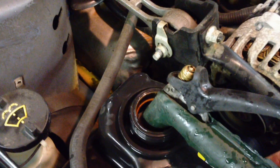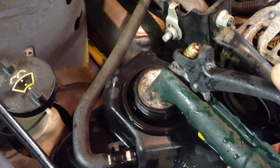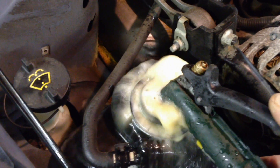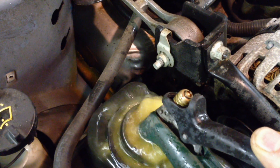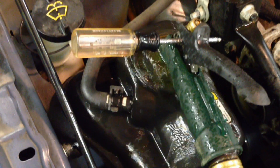Once it's started, make sure you keep filling it. As the air purges from it, keep the bottle filled to the top so it doesn't overheat. That right there is how it looks — it's orange-ish, but when I first started flushing this, there was a real deep orange rusty color. You'll see this. Let it get hot; we've got that thermostat open and circulation going. We can clean as much of the engine, radiator, and inside lining of the hose as possible with this method. While it's heating up, keep it filled by putting a screwdriver of sorts to hold the handle so there's a constant flow of water going in there.